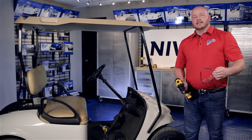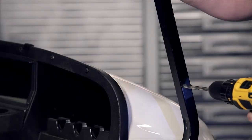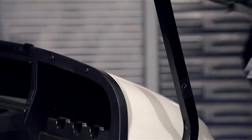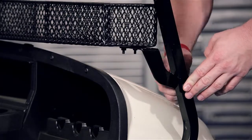Now we're going to take our safety glasses and either a 5/16ths or 11/32nds drill bit and drill through the strut. Then we're going to attach our basket and bracket to the passenger side only using the eight millimeter hardware provided — just hand tighten for now.